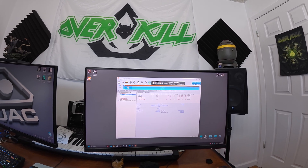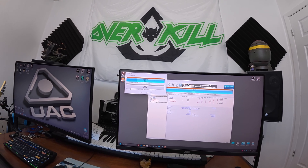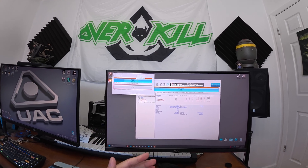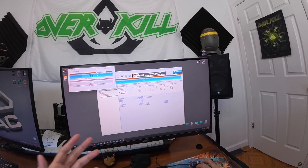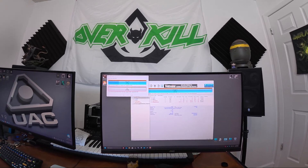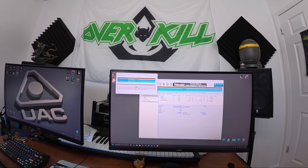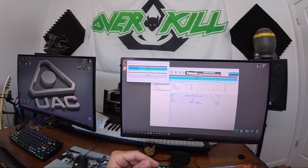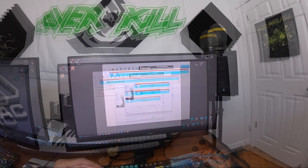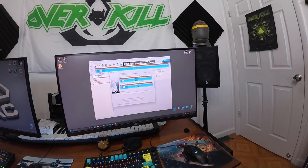You go to OS Migration and select Samsung — not the other one, because that one is used for recording gameplay, and it's a SATA SSD. We don't need it to be that fast. This new SSD is an NVMe M.2. We're going to pass it over here, start it, do a Hot Migration, and let it finish. Hit Yes, and be ready for the PC to start up.